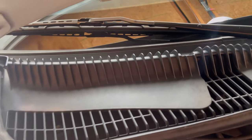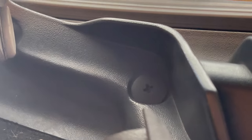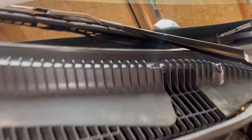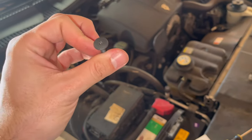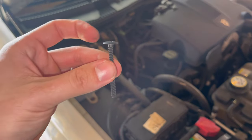The first step is to take this vent cowl off. There are two little pins — not quite screws, more like pins. There's one right there and another one over here. So we're going to go ahead and pop those out first. Be careful because they are plastic. I got my little screwdriver and took out the first one — it is actually kind of like a screw and it's very long. Get it started, unscrew it, lefty loosey, and use your fingers to pull it out carefully.